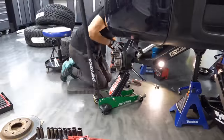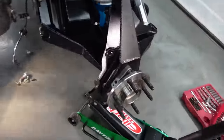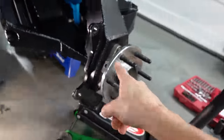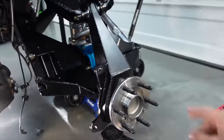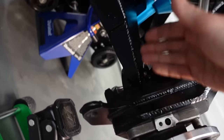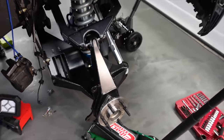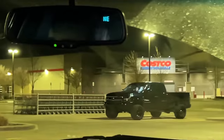That was a lot of work. Over the last hour and a half, we re-torqued everything and added red thread locker. The hub bolts came out, but I discovered the top hub bolt can't come out unless you remove the lower ball joints. So we did that — removed all the hub bolts, added red thread locker, torqued them all to 130. We got our lower arm and upper arm torqued in as well. I'm feeling a lot more comfortable now given the issue we had with our brake bolts falling out.